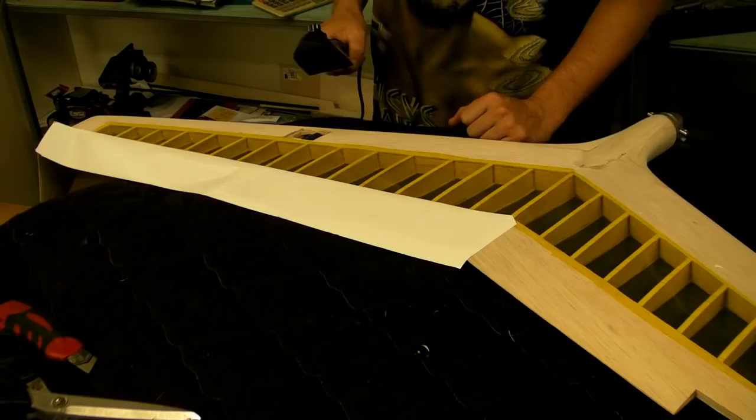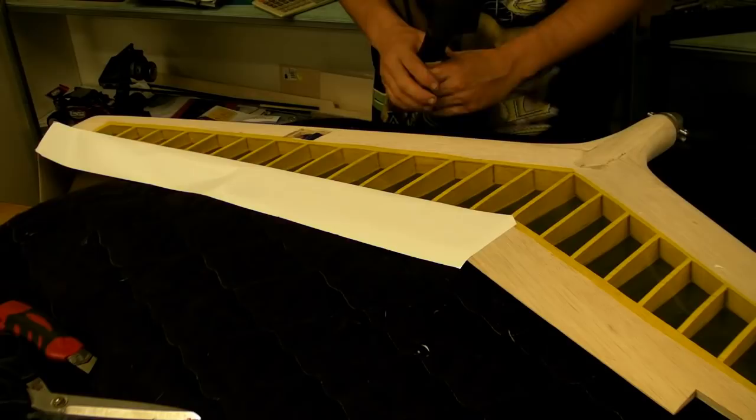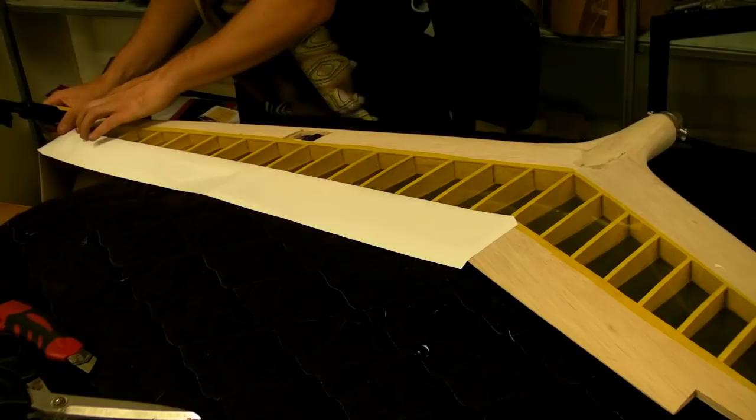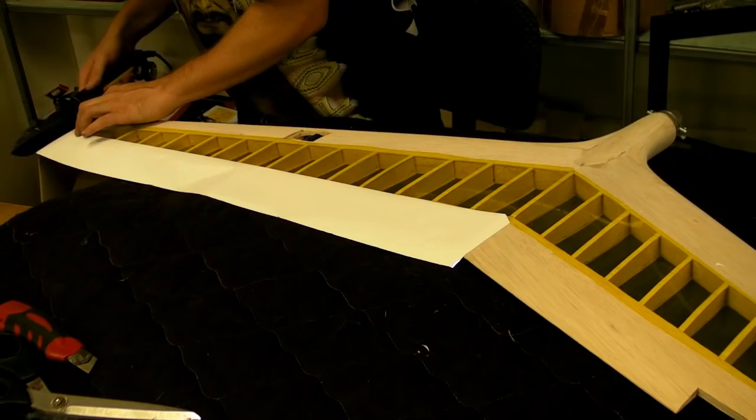It's slightly different on this one because I need this to be a very straight edge as it's going to be showing through the window. So you want to do this edge at a bit lower temperature so it doesn't shrink until you've actually got the whole thing sealed. And when you get to a corner area, just put a cut at about 45 degrees into the corner and fold each edge down and apply the heat.